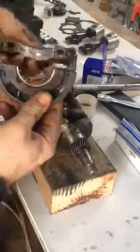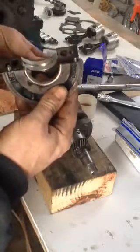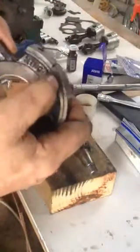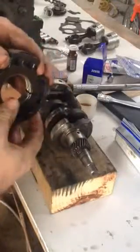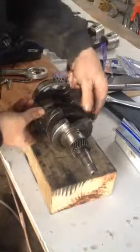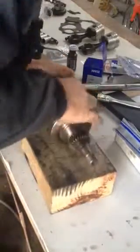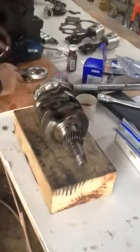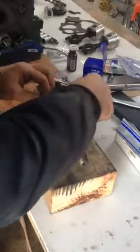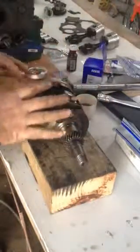So these are in now, and one of them has a groove and one of them doesn't. They both fit in together — you can see there's a notch on this here, and the notch has to be facing to the rear of the engine. So they go on like this, with two bolts, and these have to be tightened and torqued up to 30 newton meters.